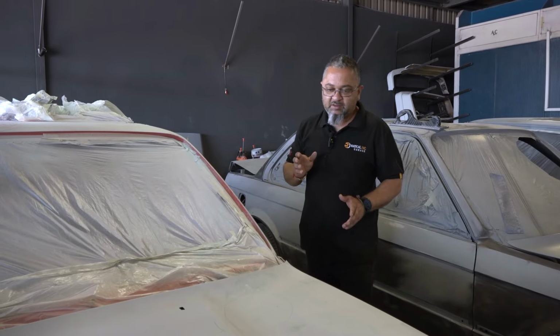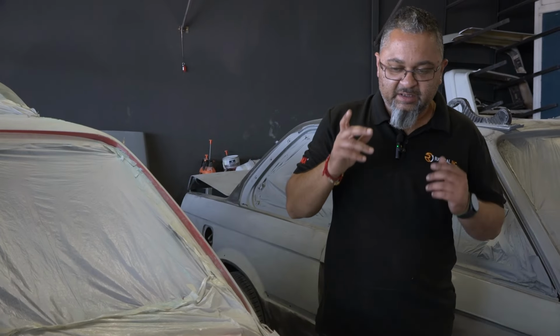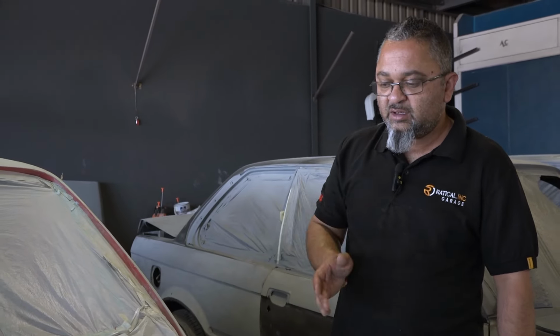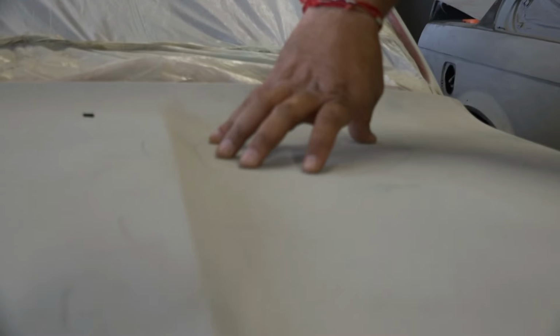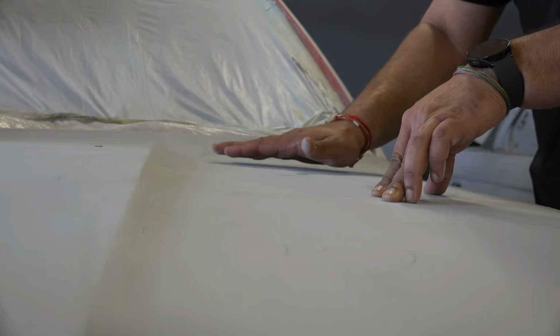We've got a light film of body filler, right? And just to give you an indication of what I'm talking about. A lot of people will see body filler here and they'll say, hey, the guys are plastering it on, and you know that I hate body filler. So here's a couple of dents here, right? If you look at the panel, it looks straight, but there's a couple of light dents in here. So when we talk about body filler, it's literally just to close up these dents here,